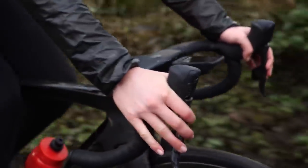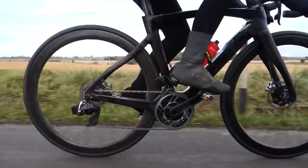Stability and control of your bike are affected by handlebar width, as is leverage when you're out of the saddle sprinting or climbing. Yes, a wider handlebar does offer greater stability than a narrower one. In terms of aerodynamic drag, a wider bar puts your body in a less optimal position, increasing aerodynamic resistance. It's all about finding the right balance. If your goal is to ride as fast and aerodynamically as possible, then you need a narrower handlebar at the sacrifice of some stability, control, and leverage. If stability and control are most important to you, go for the wide handlebar — it'll feel better when climbing out of the saddle. Just pick what's most important to you and choose your components accordingly.